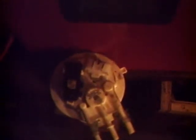Alright, I tried to drop the fuel pump in, but it doesn't want to fit. I think it's the wrong size. It's actually a little shorter, and I measured across the plate, and I think it's about 1/8 of an inch wider than the old one, and it doesn't want to fit. So I'm going to call NAPA tomorrow and find out. I got part numbers off of it, so I'm thinking it's the wrong one anyway. Yay.